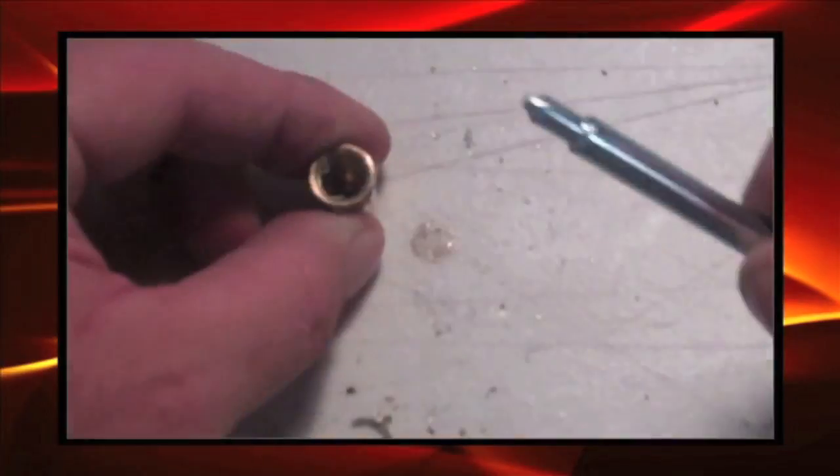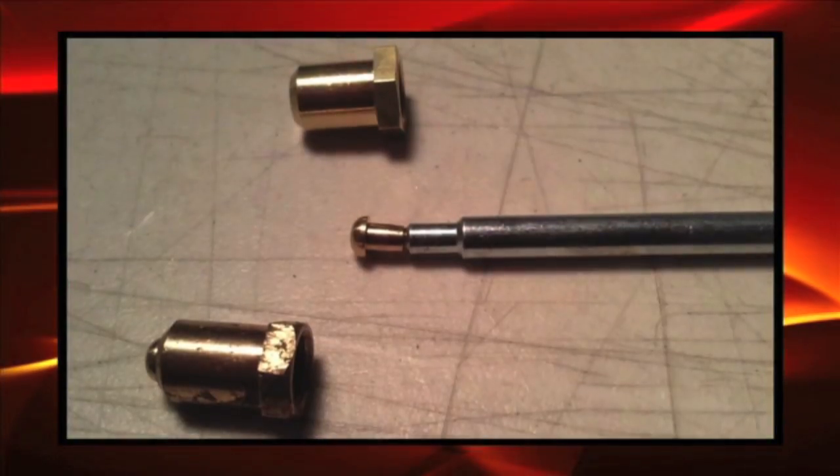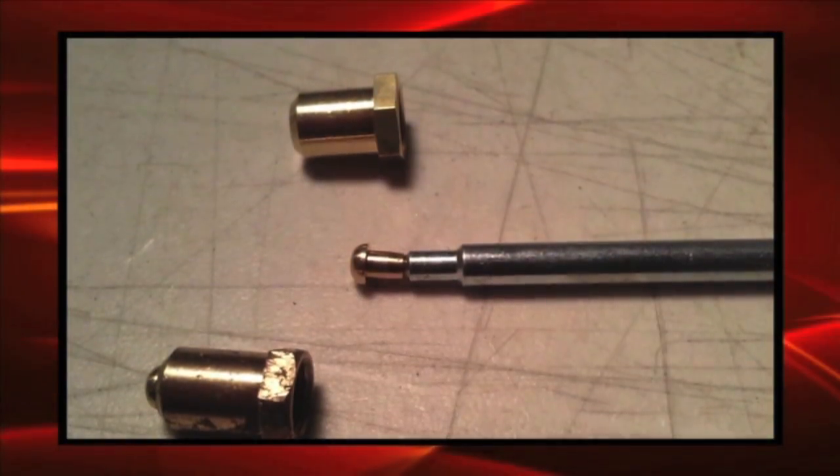Using a special punch designed like a wedge, place the orifice down, insert the punch, and smack it with a hammer. Inside the orifice, the angle of the punch spreads the stem of the spud too wide to allow the brass to be removed.